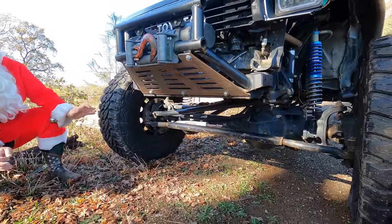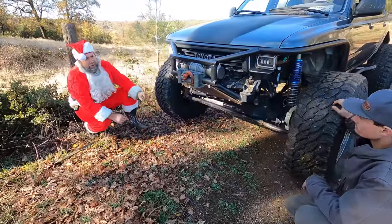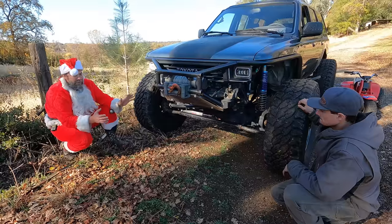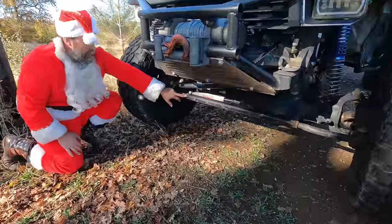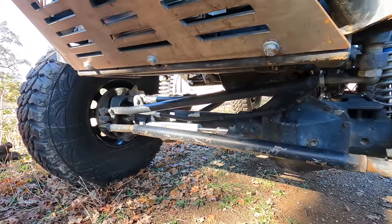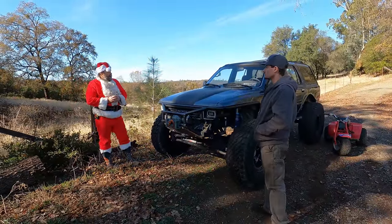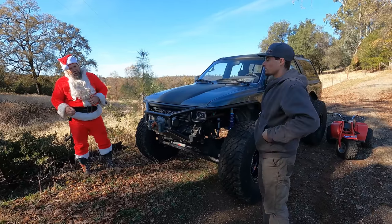So this year was a year of the small details — you got the crawl box, the hydro assist, the nice tight and clean front tube work, moved the winch up for a better approach angle. These guys get out and wheel every Friday night. This is our two-inch quarter-wall WFO tie rod — smashed and bent. This is our universal drag link kit for putting these axles in just about anything, and our track bar as well. The upgrades seem to work out good — she does a lot better on the trail now.